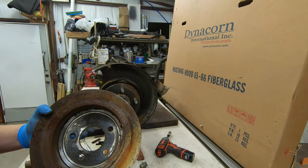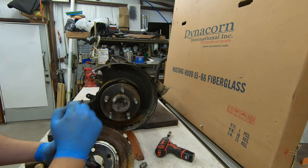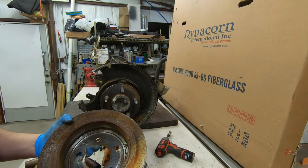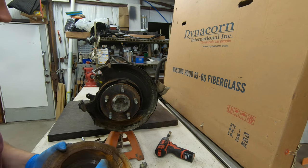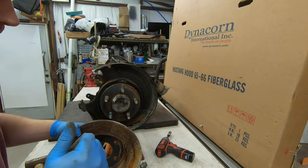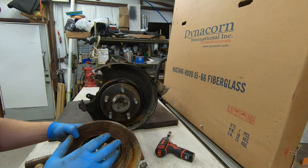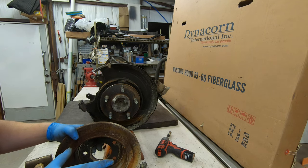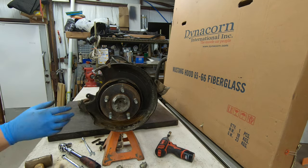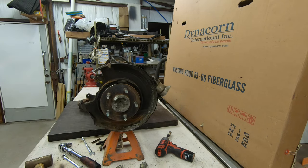If you're not familiar with this version, these cars have a little drum brake in here - and all that is is your parking brake. You have a drum inside the rotor. In years past they used to do an actual parking brake on the rotor itself; GM and a bunch of other companies did it too. It didn't work, wasn't a good idea, they got stuck all the time - bad idea. Which is why everybody has gone to this type of drum-in-hat system.